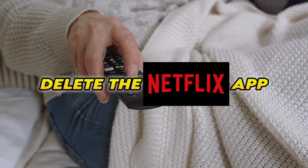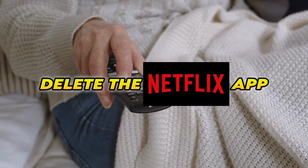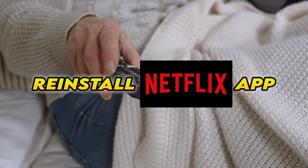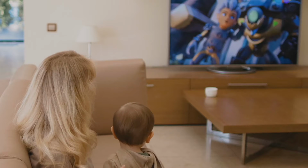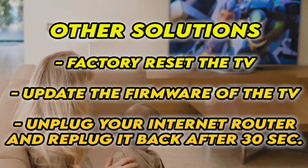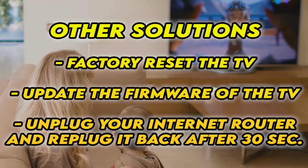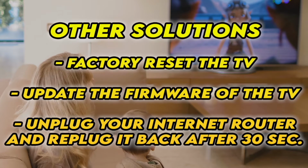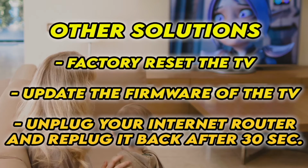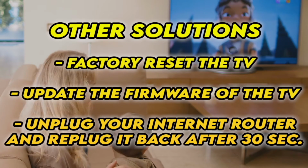Now, if this didn't work, you'll need to completely delete the Netflix app from your smart TV and then reinstall it. And obviously you'll have to log in again with your account to access it. Now, if it's still not working, I have 3 other solutions. First, factory reset your TV. There are many tutorials online. I even have some on my channel. You can check and see if your TV has the latest firmware. If your TV doesn't connect to the internet at all, unplug your router for at least 30 seconds and plug it back in. Hopefully one of these tricks will work.